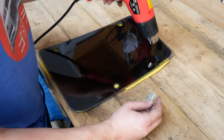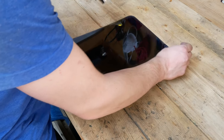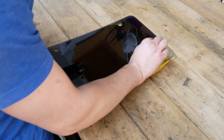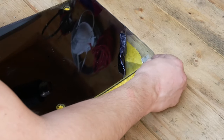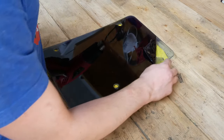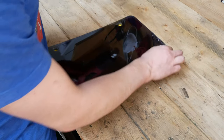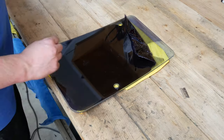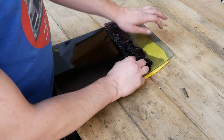You want to take your time and keep your heat gun moving across the glass. At this point I can make an attempt to really peel this back. If you're going to keep your heat gun on like I am, hold it a ways away — I can still feel the heat hitting my hand but it's not burning me. This is actually working to the point where I can peel this with my hands. You can see the perfect example here — this is the glass, and this is the adhesive part of the tint that hasn't wanted to release yet. That's where our razor blade comes in. I can see the tint wants to come off in one piece but this is all adhesive — sticky glass adhesive tint.